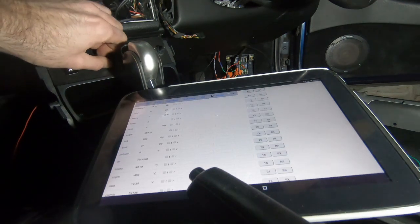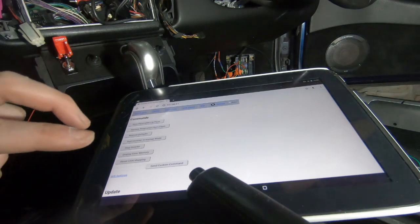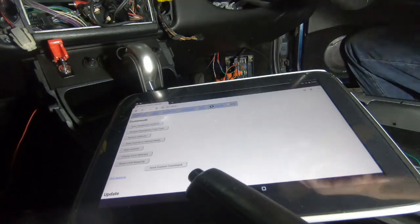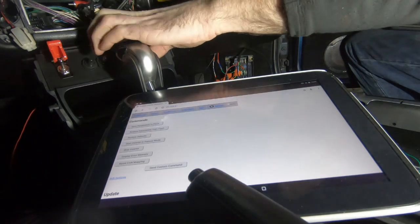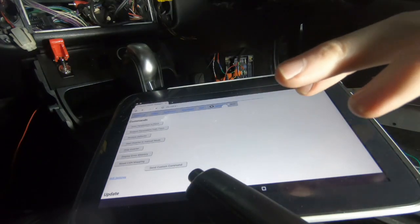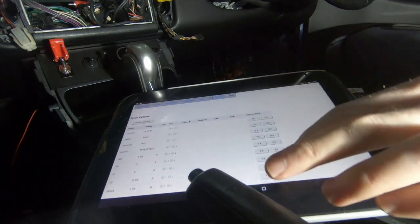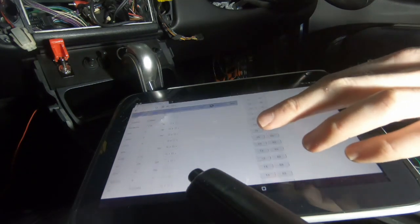If I switch that off, let's see what happens. So that means there's no 12 volt going to either the forward or reverse pins on the logic board. And we're now in neutral. All right, so we've got power. I'm going to set this to start and run. Refresh the page. Go and check the settings. It's in run mode. And direction is set to forward.